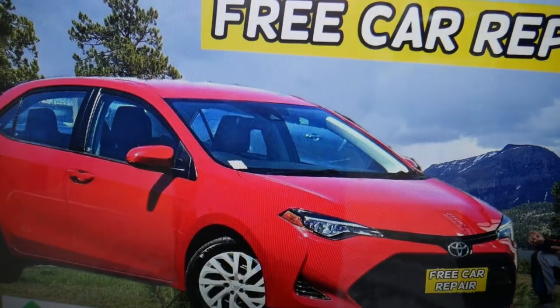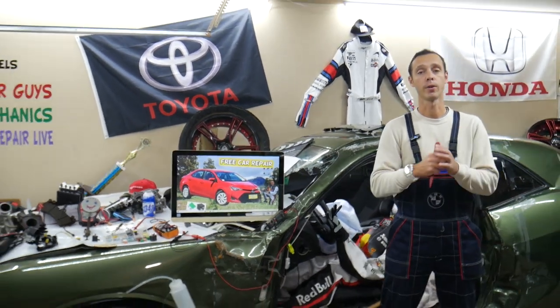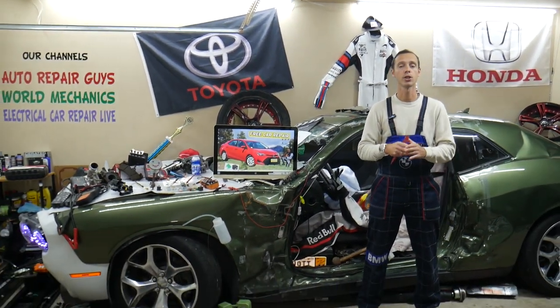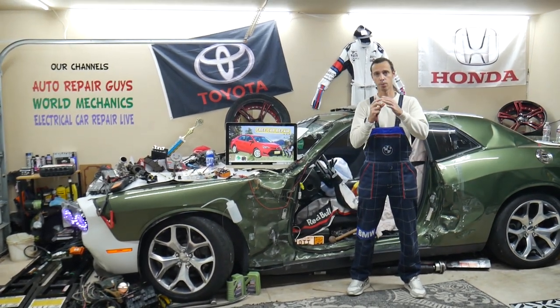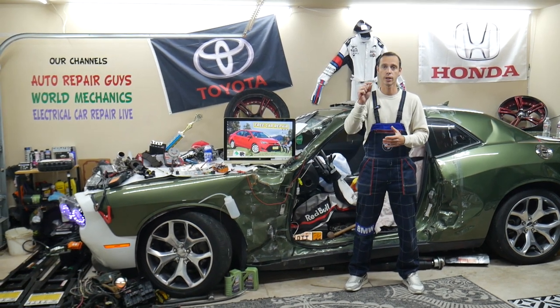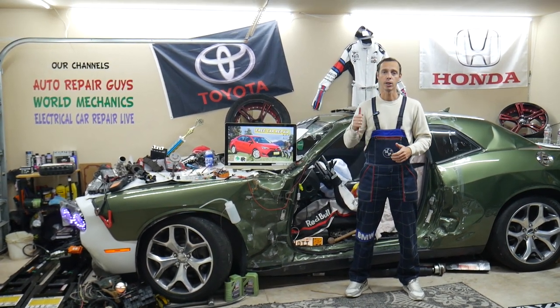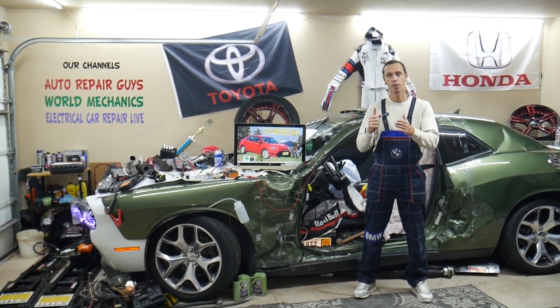Other things that can easily cause the headlight not to work: when you install the bulb, make sure you install it correctly in the correct position and that you have the correct size bulb. We often see people buy a bulb that looks like theirs, but sometimes they may differ — always check the part number. Next, make sure it's plugged in correctly.